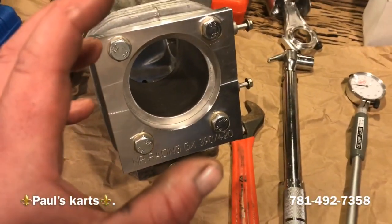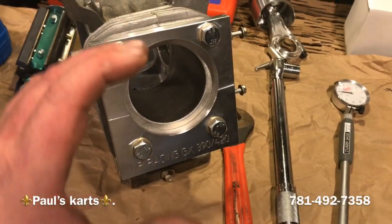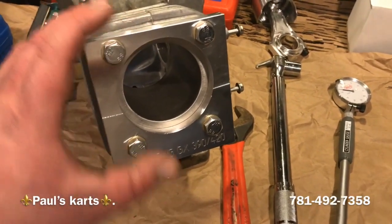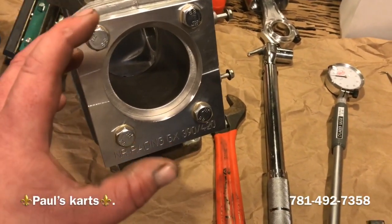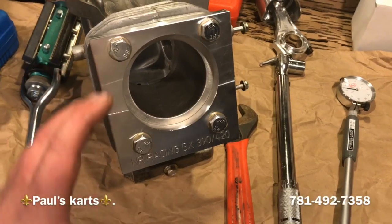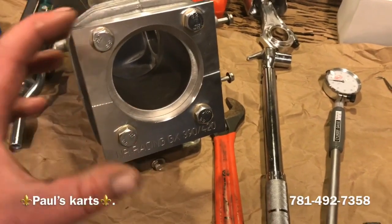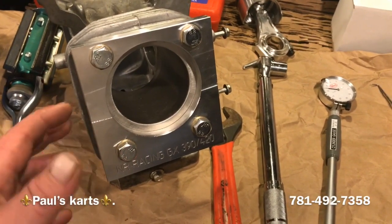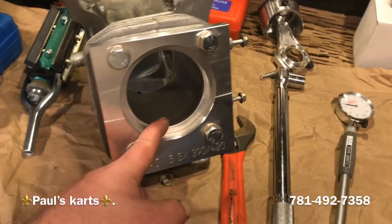We're going to go to the size of the piston plus two-and-a-half thousandths and get this back to brand-new running condition. When the cylinder is perfectly straight with a torque plate, when you put the head on, the piston rings — if there's any type of warping in the cylinder — you're not going to get a good seal between the rings and the walls, especially at high RPM. They'll start to flutter because they just can't move that fast and open and close. And so you'll lose power, you'll be down on power. This is the heart of the engine, this is where you're starting. Make sure this is true.